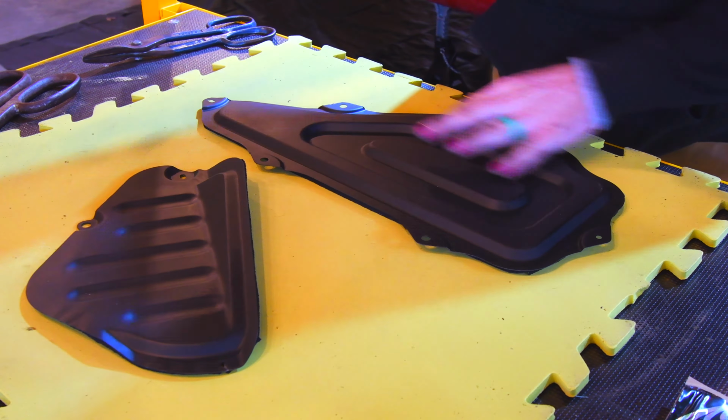And we'll also talk about some of my favorite tools. The Dynamat kit, of course, recommends you get the Dynamat roller, which is really just a really hard, small roller. In fact, if you have normal size hands, you probably don't want this one because it literally just fits and you can't get a lot of leverage. I'd rather have one that's about twice as long that I could get both hands on because of the amount of force I have to put on the mat to get it into every nook and cranny, which is very important.